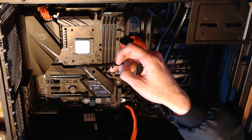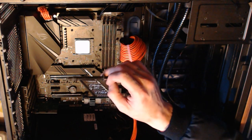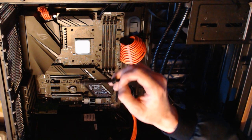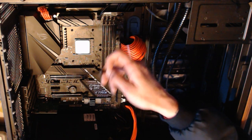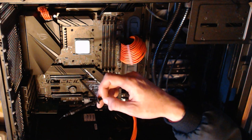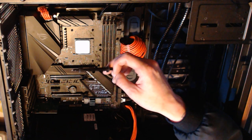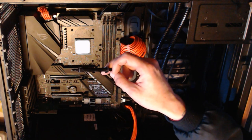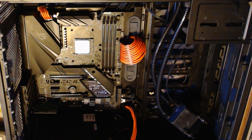You cannot use it with a heatsink that contains aluminium, because liquid metal contains gallium, and if you know anything about gallium, it can eat through aluminium like butter, and it will just destroy it. So you do not use liquid metal with anything that's made of aluminium, especially cheap CPU coolers, sometimes they don't even put a copper slug on the bottom. If you've got a copper slug on it, then you're fine. But if it's just pure aluminium, then I would stay clear. Do not use liquid metal with aluminium heat sinks. Only if you've got a copper bottom, or a full copper cold plate.